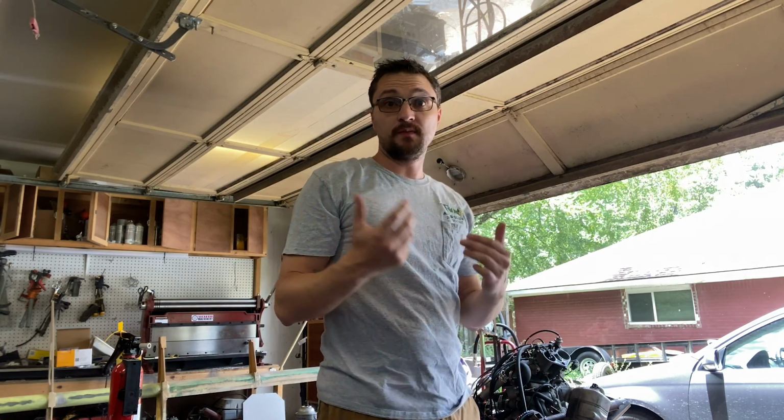Okay, so that successful test was what I needed. What we've now done is confirmed the engine will free rev. There's always a couple of things that have to be grounded or not grounded on the harness that are normally going to things like the reverse system or oil pressure switches, stuff like that. That all needs to be set up properly, otherwise the engine will limit its revs. That's a thing that Yamaha, I'm realizing, does fairly consistently across the board. We finally have that set figured out.